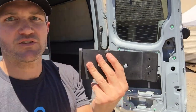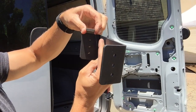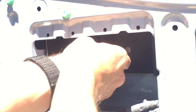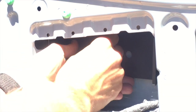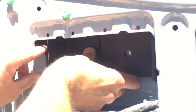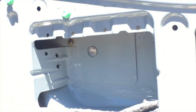These are the hockey sticks — you have two of them. This side goes flat against the hole and then these actually lever over. You stick this behind the sheet metal of the Mercedes and down, then put some bolts in it. So line that up over the hole. You can take one of the bolts it comes with and stick it through that hole temporarily to keep it lined up. Then mark your drill holes — make sure the bracket is flat — and mark all four. If it doesn't quite span the gap, that's fine. There are some ribs that stick out a little, so we can't make it wider, but it's fine. Mark your bolt holes and drill those out.